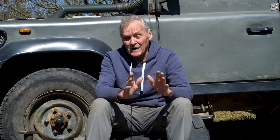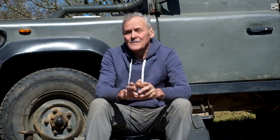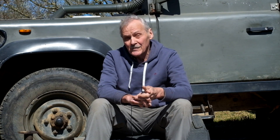Secondly, the handling of alternative charging sources. One of the touted advantages of these chargers is that they often contain an integrated solar charger, and some also have a mains charger too — but to my mind you want to keep them separate. I have separate solar and mains chargers, both very good and not that expensive, and it means if the main unit fails I can always rely on one of the other charging sources. Also, you want to be able to charge either battery from these alternative sources. To the best of my knowledge, all DC-to-DC chargers only charge the auxiliary unit. I have a simple toggle switch so I can decide which battery to charge, and a few years ago in Eastern Europe I did have charging problems and had to use the solar panel to charge the main battery for a few days. If I'd been relying on a DC-to-DC charger I would have been in great difficulty.